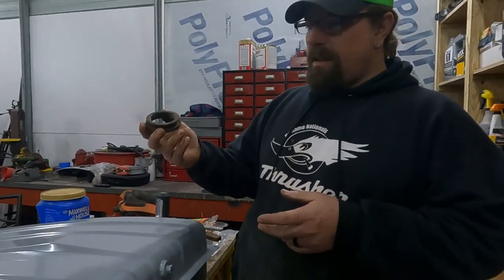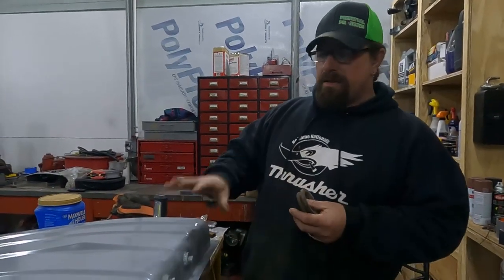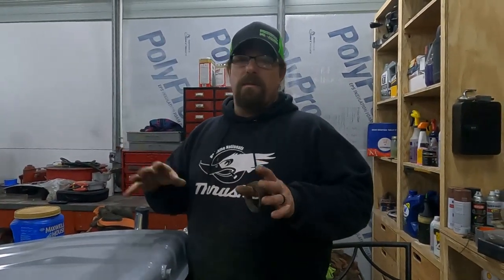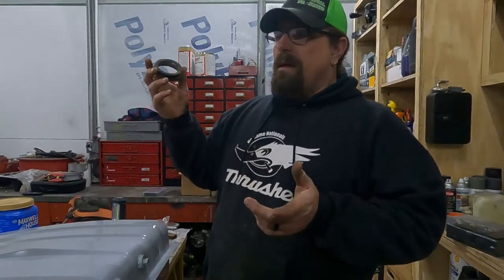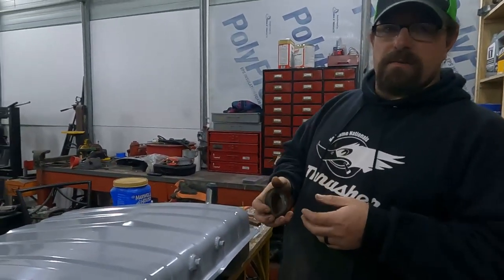So this is on the way. We're gonna go ahead and get the tank up in there, and then we'll put a sending unit in, run our fuel lines, and then, well, no, before we run our fuel lines, we're gonna blow all the fuel lines out that are on the car, and hopefully don't find any holes in them because I don't have any replacement fuel line. But that's the next step, get the tank in there, and Amber will probably do some B-roll or something as we're doing this.